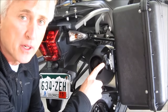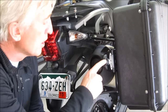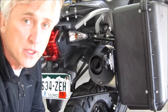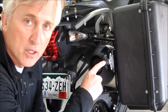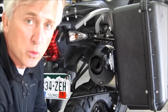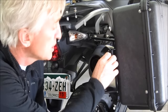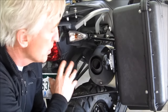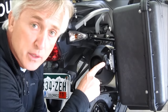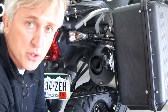There are a few important details about our latch you should know. First, it has a key lock so you can lock the case to the bike for security. Secondly, the latch is designed to break away in a very hard crash — a simple tip over won't do it. What happens in a crash is the latch breaks, the case ejects from the bike, saving the rack and the subframe. In other words, you break an easily replaced $25 part rather than cause expensive damage to the bike.